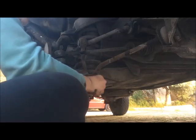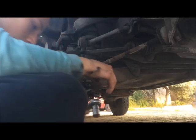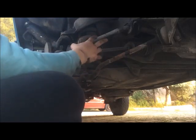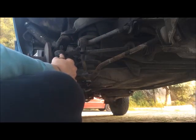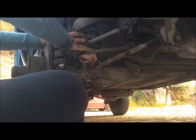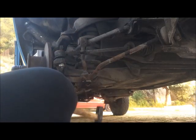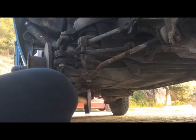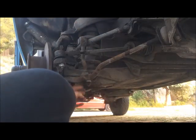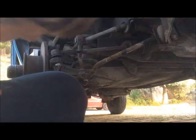You also have to make sure what kind of sway bar you have. It's 21 or 23 millimeters. I measured this. This is 21.8. I asked a lot of guys, and so it's the 21mm one. Now take your hammer. As you can see, they're destroyed. Here they're falling apart. We will remove them later on. For now, that's good enough.